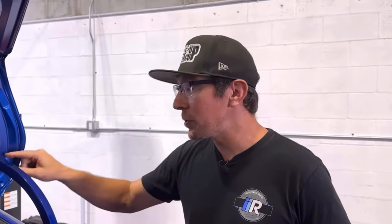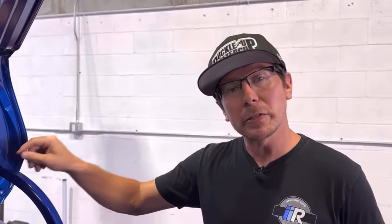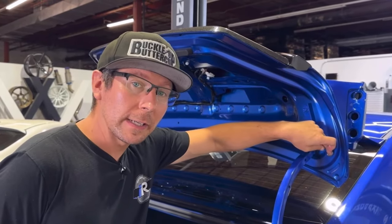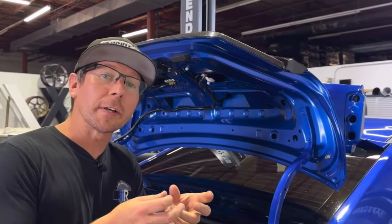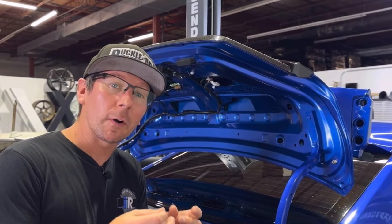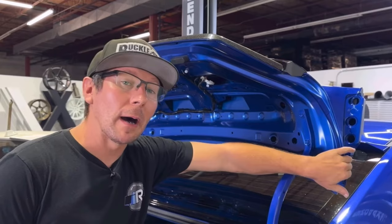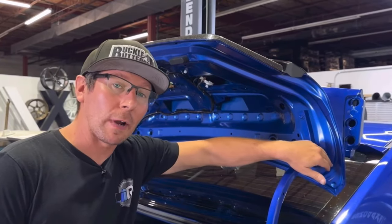With all three pieces of hardware installed, we're going to go around and final tighten every one. But before we do our outer edge hardware, we're actually going to remove this, add a dab of Loctite, then reinstall that piece of hardware. The reason we're doing that is because we have the two layers of metal here, so the bolt will actually start to compress that metal together before it fully tightens. Adding the Loctite allows us to get a full bond to our base while not over cranking our hardware down. Now we can grab our second base and repeat all of those steps for the other side.